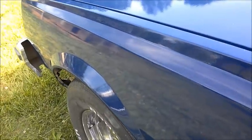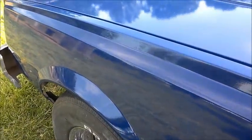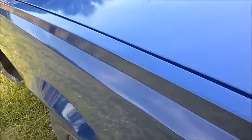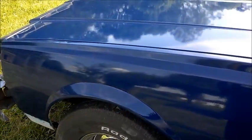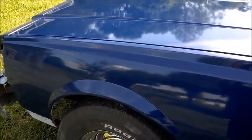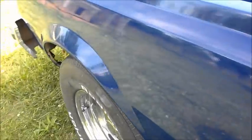But you can't tell it's been fixed. It's got a little bit of waviness in it, but you can barely tell. It's real easy to fix repairs on this thing. I didn't think it was going to look too good right there — you can see a little bit of waviness — but a couple more coats and a wet sand should take that out. But you can barely tell. All the paint peeled up and I had to wet sand it and feather edge it out, and I fixed it pretty good.